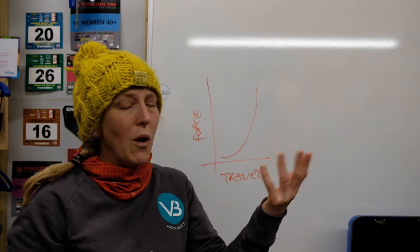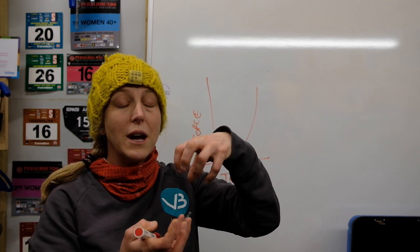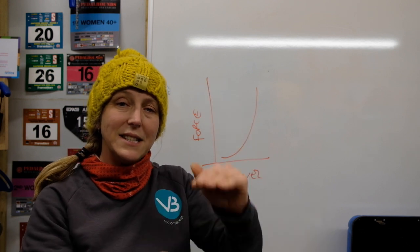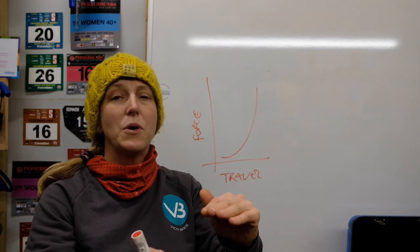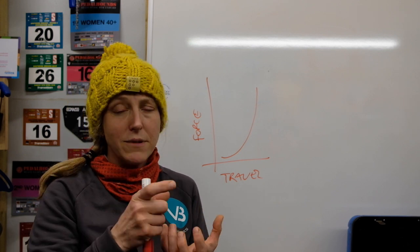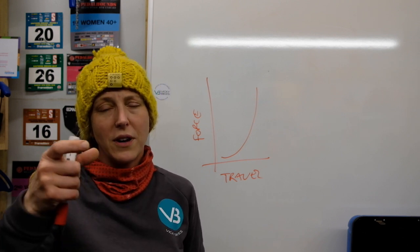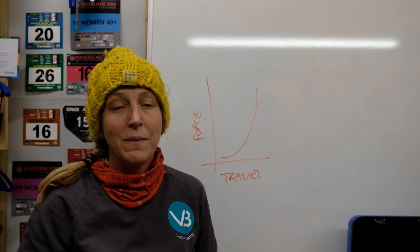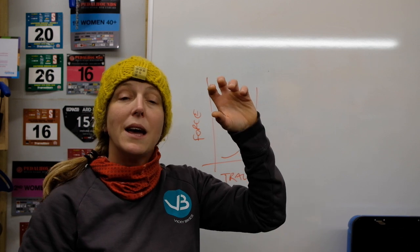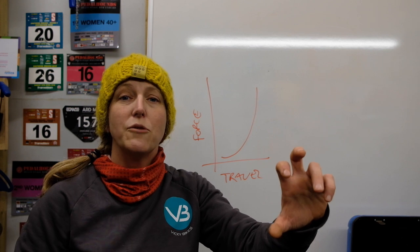So what we use is a thing called a negative chamber, which is in the same fork and balances it out. The larger the negative chamber, the easier it is for the fork to start moving. It overcomes what's called stiction. Stiction is basically the inherent resistance that you have to overcome to get the fork moving. So having a bigger negative chamber is great, because it gets it moving more easily and it keeps it moving and assists you right the way through.